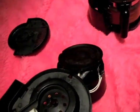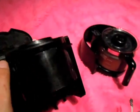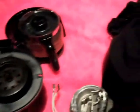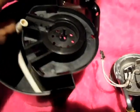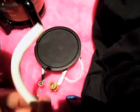The only route of escape is through this tube up here, which connects down into the coffee grounds and then down into the coffee pot. So water goes: down from the reservoir, through the hole, through the valve, gets hot in the tube, then gets forced up and out through the coffee grounds into the pot.